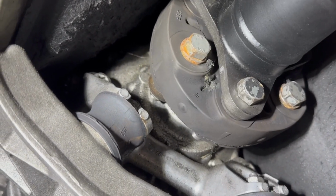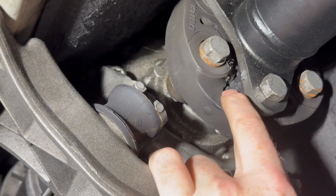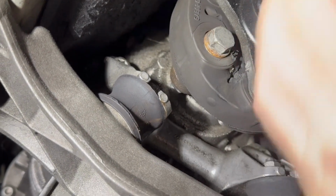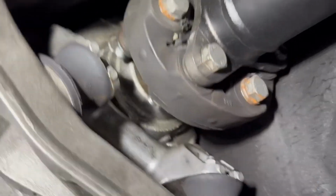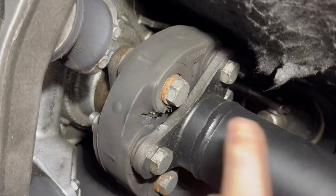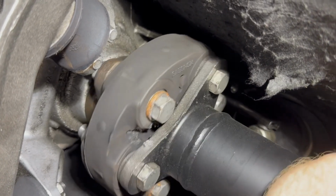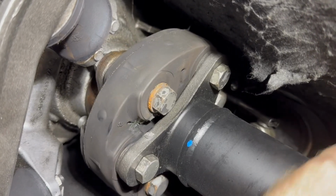But every other one has a massive tear in it where that expansion zone is, and it's like it got hit back and forth into itself. The witness mark, God, there's no room under here. The witness mark that I'm talking about is right here. So it looks like this bolt contacted this flange, and it's on every single one, right?